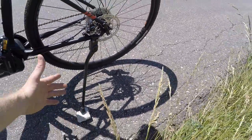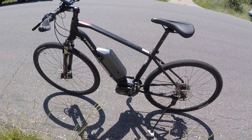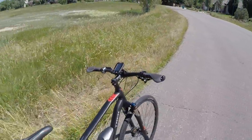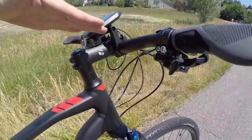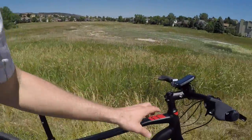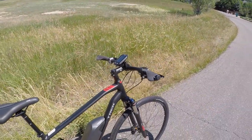Standard kickstand here — not adjustable length. I'm using a rock because I wanted to stand this up straight for photos. Trek's bikes kind of have these basic kickstands and the bikes lean a little bit more, but I think they probably lean it so it doesn't tip as easily. Coming up to the cockpit, you can see it's a 90 millimeter stem with seven degree rise and they flipped it, so it's a little bit more aggressive right now. They've also got a 20mm and 10mm spacer so you can get an even more aggressive position.